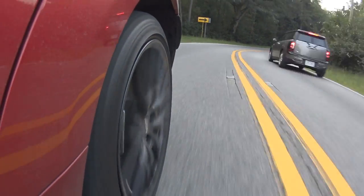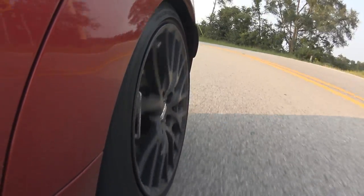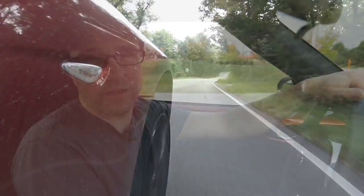It's just so satisfying. The other thing too is reviewers have talked about how this car just tends to roll around a lot. And one of the reasons why Mazda has engineered roll into the suspension is, and this is a quote from them, they tend to put more body roll in the Miata because most of the best roads in America, at least, have some of the worst conditions, or they're the worst maintained roads. So you want to go on a twisty road, a lot of times the pavement is in bad shape. Having that extra compliance in the chassis, having that extra body roll, really helps to keep the car in line. It's not hopping and skipping all over the place, and it's more comfortable. So while there is roll here, it's engineered on purpose because this is a street car mostly, right?